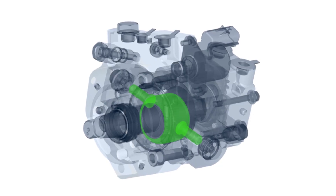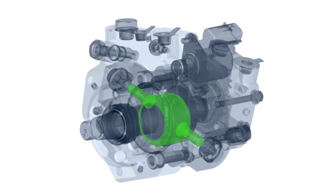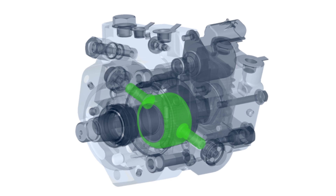The DCR internals are completely different. We've got some displays made to show the internals of the pump, but it uses an eccentric cam and a large bushing surface — it's just a much more heavy duty bottom-end construction. That helps spread out the load of the force from the pistons pumping fuel at high pressures — we're talking 30,000 to 40,000 PSI in some cases. Also, the flow path of the DCR is different from the CP4 where the bottom end can contaminate the rest of the system. Overall, there are key base design changes that are very significant and critical to make it a reliable, robust pump that can take a beating.